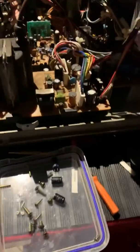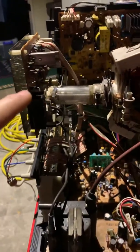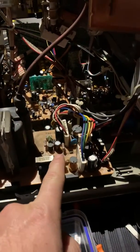I had to replace three capacitors: one on the neck board, one down here next to the flyback, and one in the vertical deflection down in the bottom.